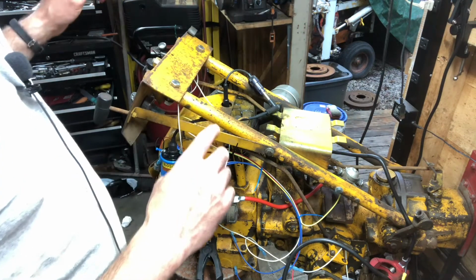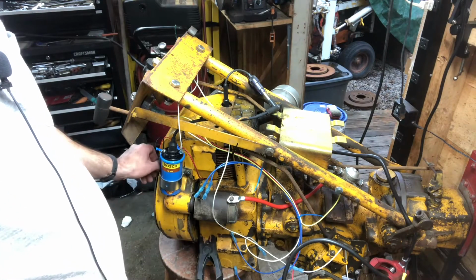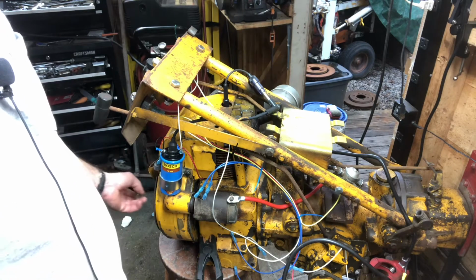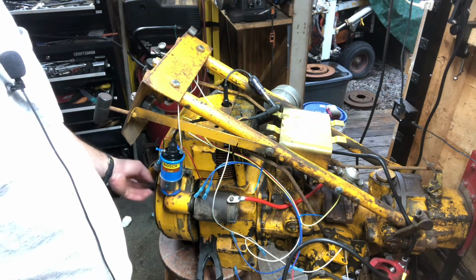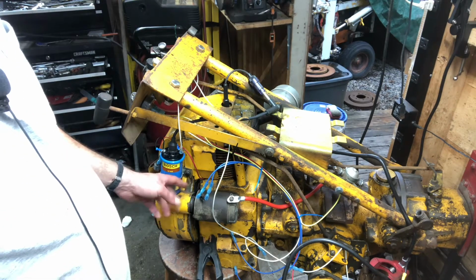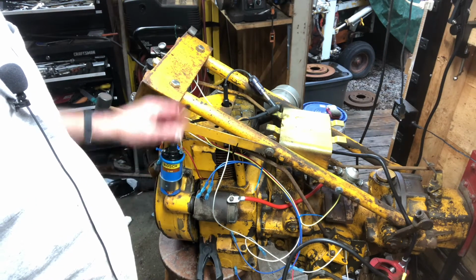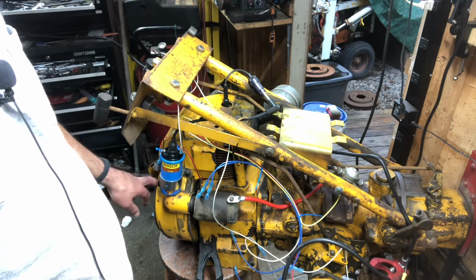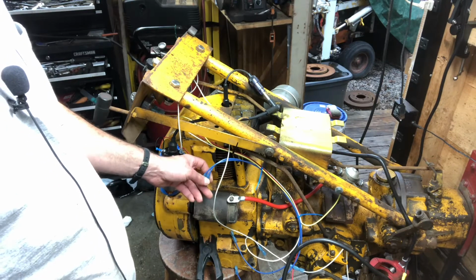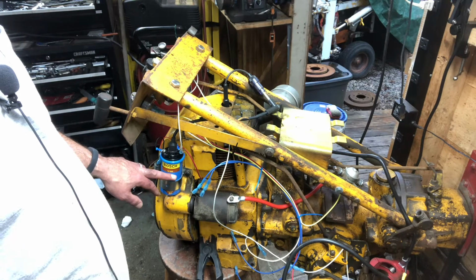But basically, I got a Transdenser. I'm sure a lot of you have watched Terrell Fixes All, so I purchased a Transdenser to basically take the place of a coil that was under the flywheel. So basically the flywheel, the stator and all that, I trimmed the coil out, took the spark plug wire off of the stator in there, and I'm just using that stator to recharge the battery, and that's it. So I added an external ignition coil.